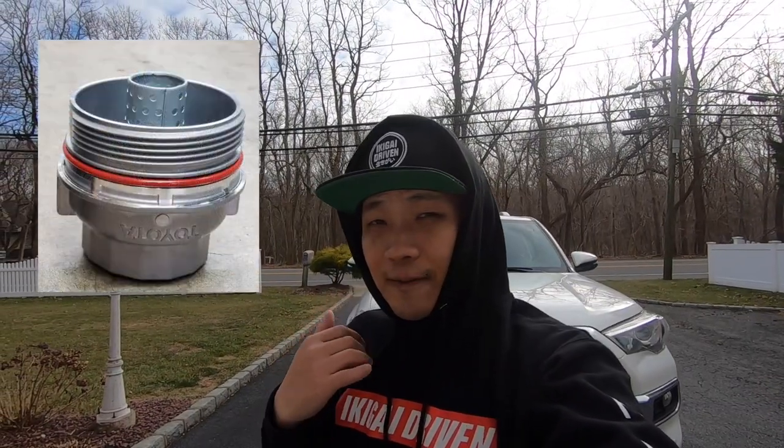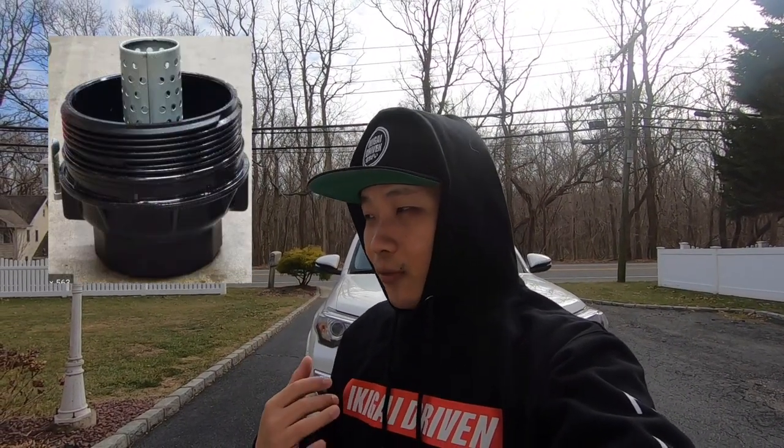The main point is we're switching from a regular Toyota paper filter to the TRD filter, because the TRD filter has a seal on it so all the oil actually goes through the filter and gets filtered. The other upgrade is the metal oil cap — these fifth-generation Toyota 4Runners come with a plastic oil cap, and if you bring the car to the dealer they typically torque it on way too tight. There have been many cases where the plastic cap has broken off, so upgrade to the metal oil cap.